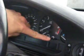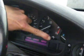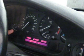To start, press the right check control button while holding the button down. Turn the ignition on to the first position until you see test number one. Using the left control button, select the option test number one to see your VIN number.